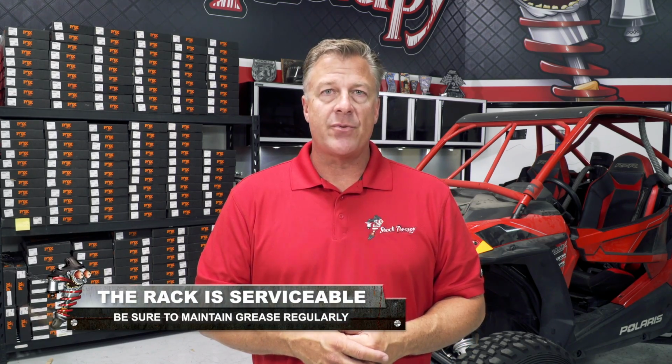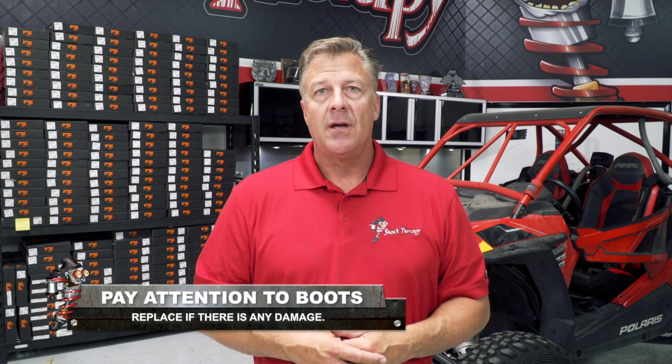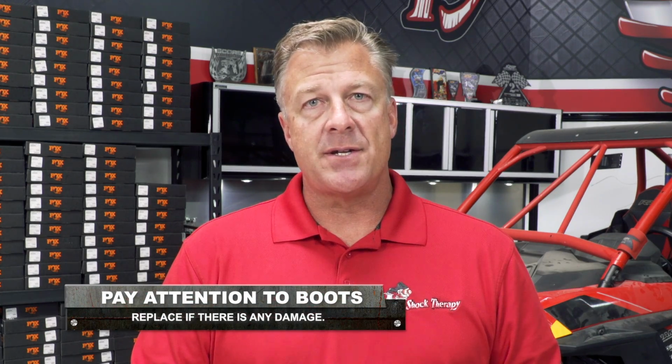Keep in mind that this race rack needs to be greased every 300 to 500 miles. Failure to grease the rack over time can cause it to run dry and prematurely wear. Another thing that we want you to watch is the wear of the boots on the end of the rack. Sometimes you can get branches and other things up in there that can cause a cut in the boot and allow dirt and debris to get inside the rack. If you have any issues like this, we sell the rack boots separate on the site and you can replace them at any time.